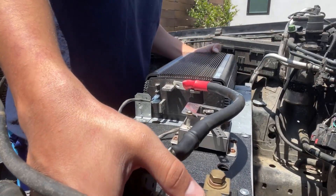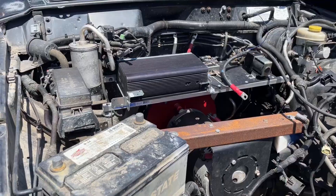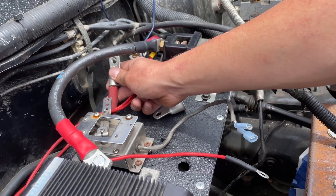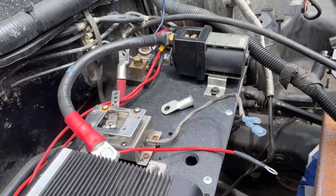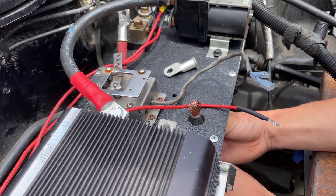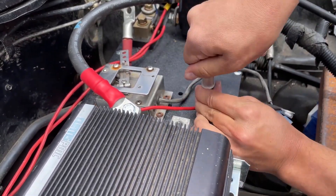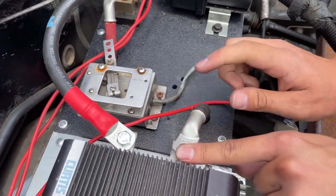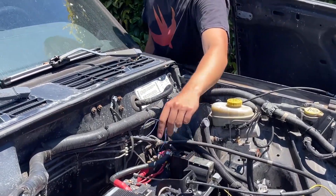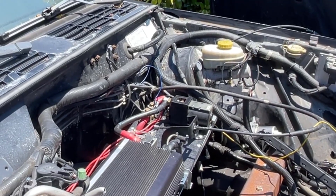After a bit of fabrication, it was time to mount the platform into the engine bay. This is what the engine bay looks like right now. Once the cabling was in, I began connecting the high-voltage positive and negative cables running from the battery pack in the trunk. The positive cable connects directly to a shunt, and the negative cable connects directly to the motor controller. I also attached the throttle cable to the potentiometer and did a quick test — it seems to work with the gas pedal.